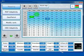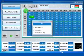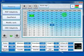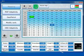But if we want, we can change the values of the map, so we can see how the petrol time injection is changing. For example, I will add 20 points to the whole map. Okay, so now you see that we are far from the point of before. Time injection on petrol is lowering, because we are too rich, because higher number means richer mixture and lower number means lean mixture. Okay, so we get back to our first map that was tuned in the right way.